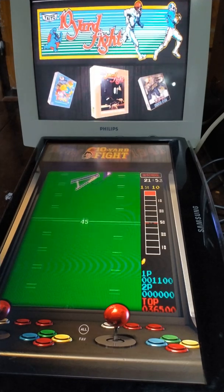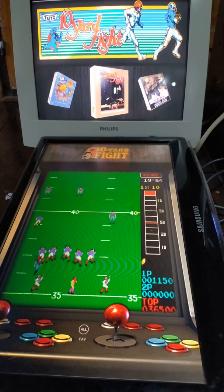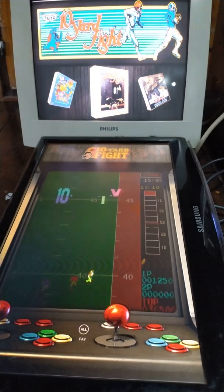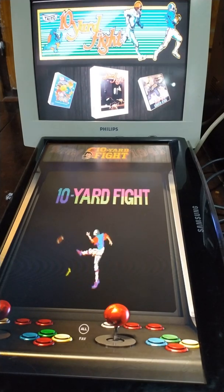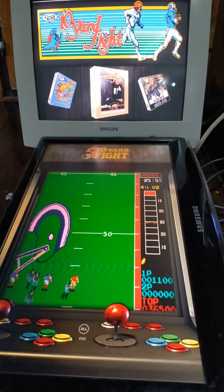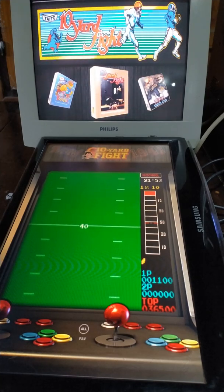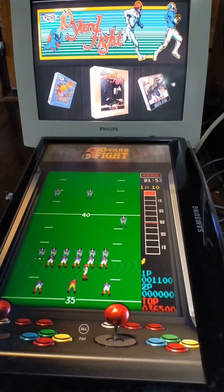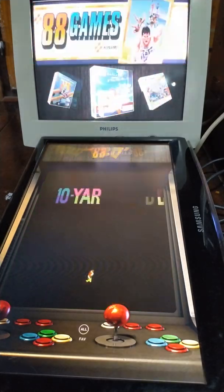So, why I showed you this weird configuration of monitors — this is the cheapest that you can go with this mod. I have a 1360x768 LCD 19-inch monitor for the playfield, and the back glass is a CRT 15-inch 1024x768 monitor. So this is as low as you can go, at least for this build, at least for this setup.